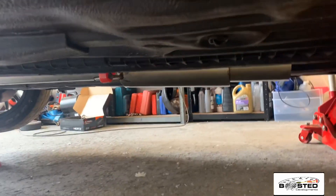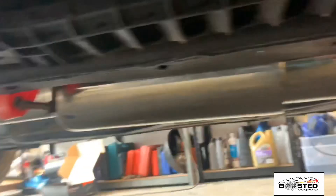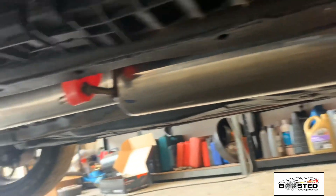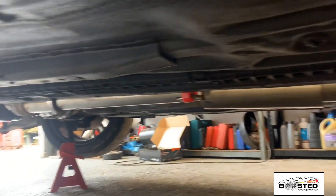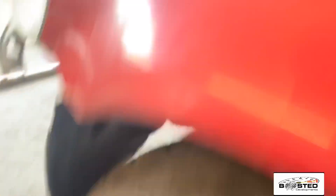Because I was in the zone, I decided to keep going, but I need to order another PowerFlex bush. I'll be bringing up my sponsor XR Racing to get one sent straight away. But I'm really happy with the way it's come out. I've done one hanger and I need to do a hanger the other side — I'll have to weld it to the car since the car's got one that side, and also weld it off the exhaust. She's sitting up on her own at the moment but it's a bit too loose — with one on each side with solid rubbers that will stop it from moving. Really, really chuffed with that. It's going to be scooping down — can't wait. That's the full exhaust system from the downpipe onwards.